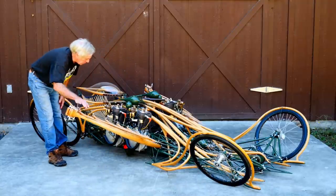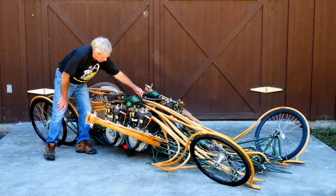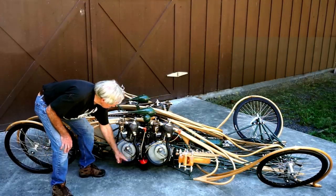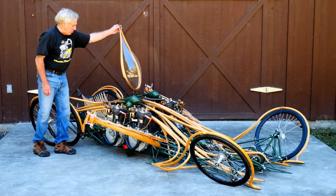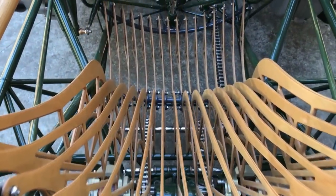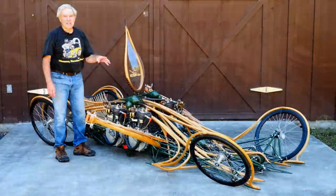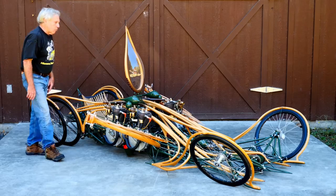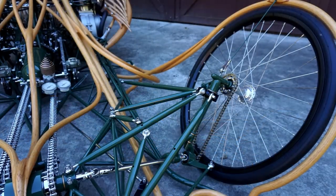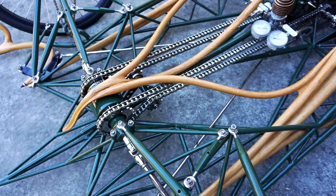This is a better shot of the motors. This is the gas tank, the oil tank, the throttle working, the exhaust. The spark coils are under here. And this is the entrance point for the driver — you sort of slither down in here. There are fifty sprockets and over forty feet of chain, some of it pretty darned exposed. It's got four wheels; the front can steer. Those drive wheels are purely aesthetic, although the drive would work fine. There are spur gears, so this is a real differential. In the back, the outer wheels are torsion sprung.